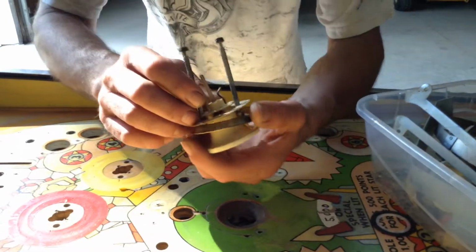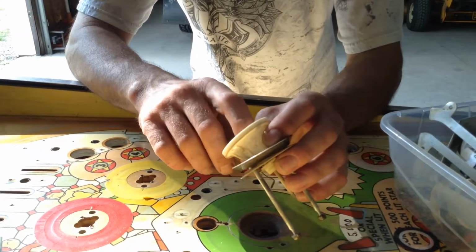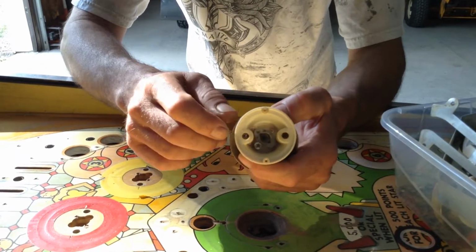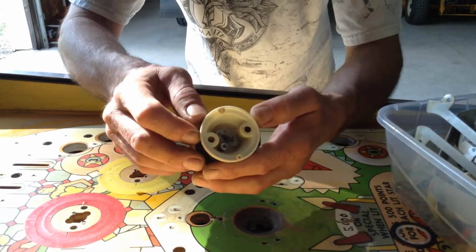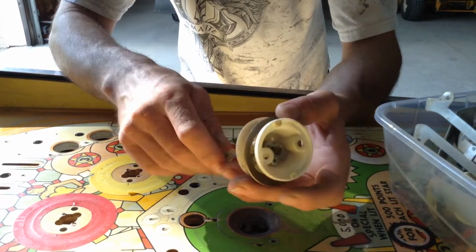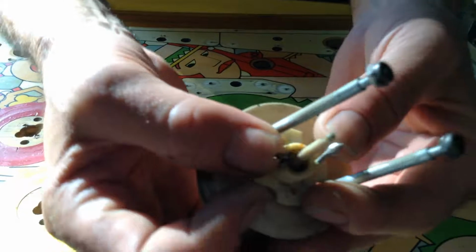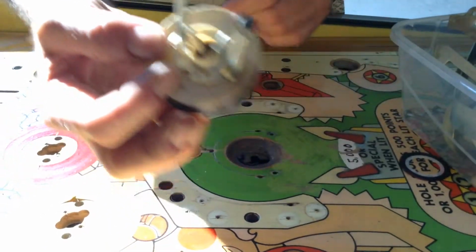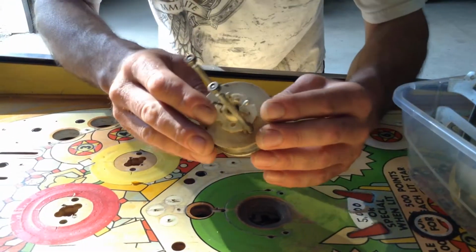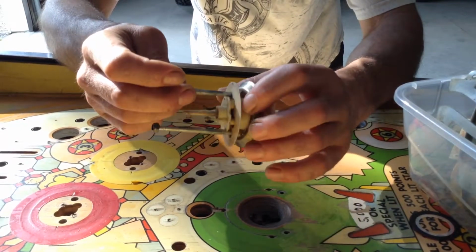Our bumper covers. And these have a light in the bottom of them, down here, a light socket. You can get these wet. It won't hurt them to be in there soaking a little bit because there's little contact points down in here where these little lamps turn into, like the old style flashlight bulbs. We'll have to get in there and clean and polish the bottom and the edge of these. On the back side of this here, I said earlier I nipped the wires. I cut them right at the very, very tip where the connection is. Don't chop any more out and try not to cut your contacts that run up in. But all this stuff can be submersible. This piece here, again, a piece of fine steel wool will polish this up.